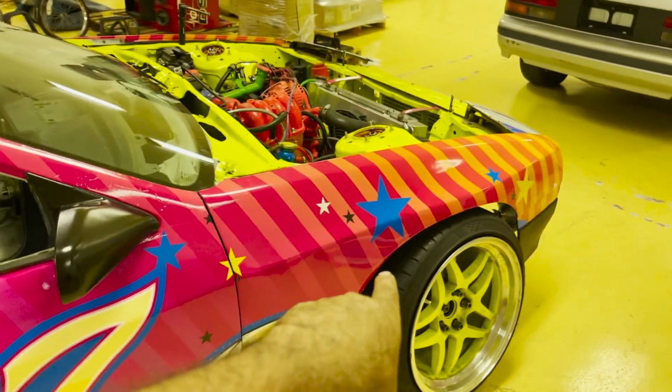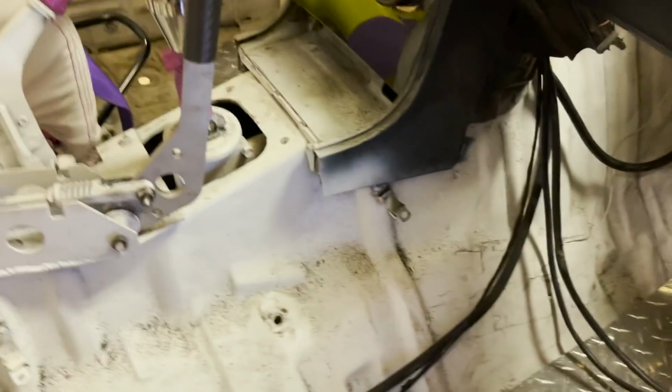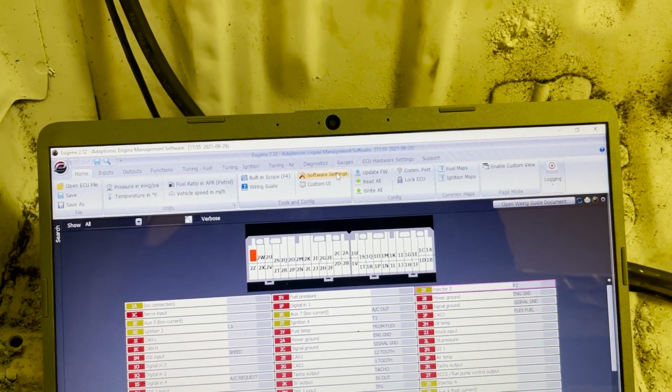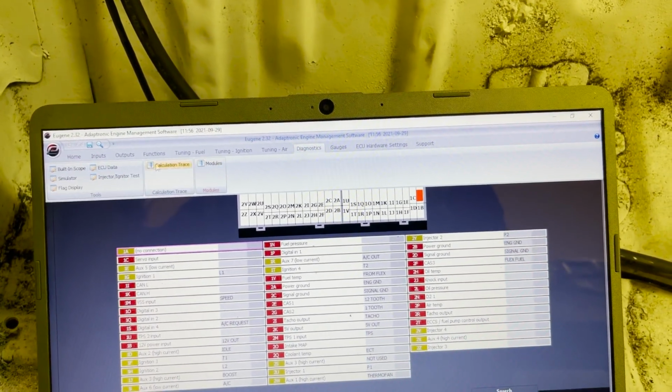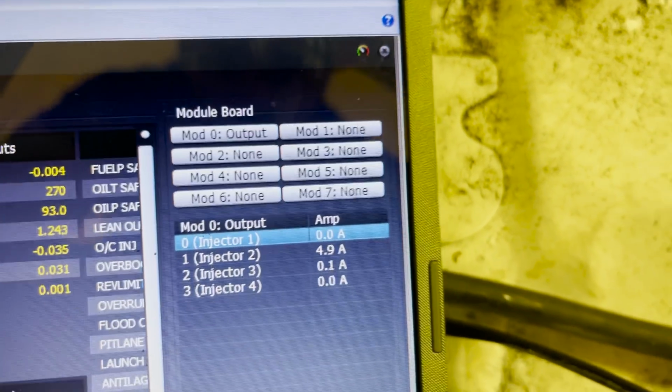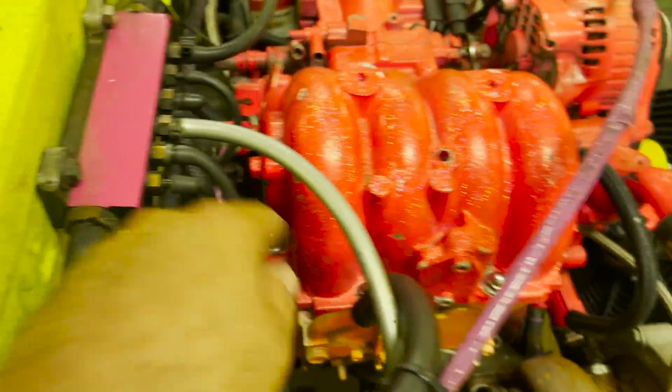So we're taking a look at Sailor 7 also. It keeps having a problem where its fuel's coming out of the wastegate. If we go over here to Diagnostics, ECU data, you can see one of the injectors is already opening while the other ones are closed. So it means that injector 2 on the primary on the rear is opening. No matter what you do, like running off or whatever, it's still injecting fuel.